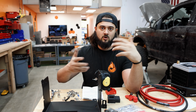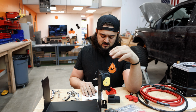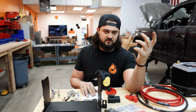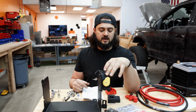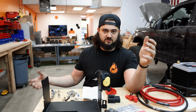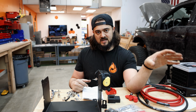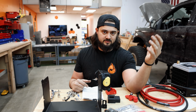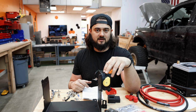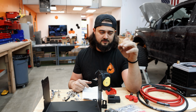That's kind of the smart alternator thing on modern cars. This gets around that for you. And then if it's below 12.35 volts for 10 seconds, below 12.75 for 30, so on and so forth, it'll disconnect them because it's basically seeing that it's no longer charging from the primary battery. It'll disconnect the circuits and allow you to isolate that secondary battery to use all of your aftermarket goodies while camping or doing whatever without draining your primary battery, meaning that even if you kill it, when you go to get into the car in the morning, it'll still start.